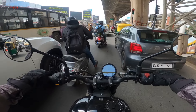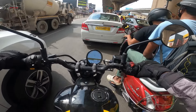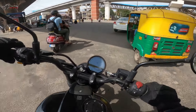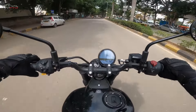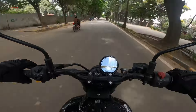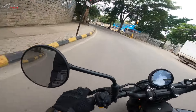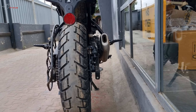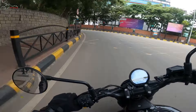That is why the bike hesitates at lower gears. The tachometer seems to be disabled for some reason. If I hold the clutch and leave it, the bike will actually stall. That's one character of the engine which is really lacking. Let's see how the tyres hold up and how well the suspension handles curves and turns. The suspension is handling the breakers really well. You can literally hang off the bike - the tyres are quite grippy. They are not sports tyres and not off-road tyres, although the tread pattern suggests off-road capability, but it is not.